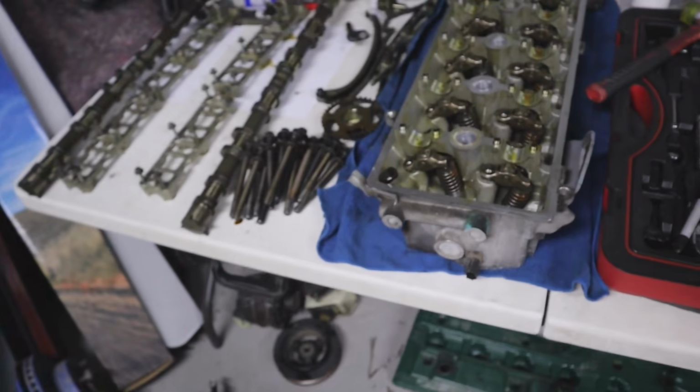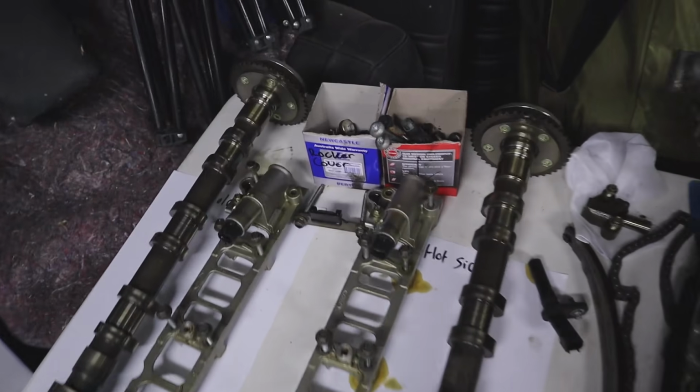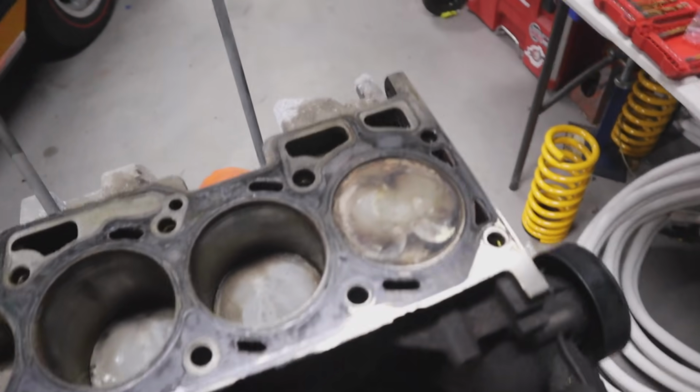Yeah, we just picked that up yesterday, which was Sunday, which I don't know when this video is going to be uploaded. So we're going to take the engine that's out of that now, and we're going to go the boosted LPG engine, mainly because they have the forged rods. Well, not forged rods, they have thicker rods than the NA engines. So we're starting to strip down in this first episode. As you can see, we've got all of our parts on the bench. Everything in nice, good order here, with the engine looking in good condition.